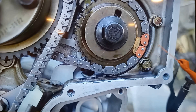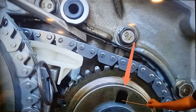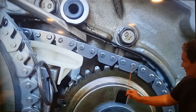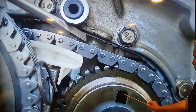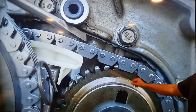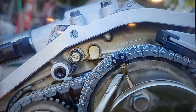On this side, you can see the arrows lining up — timing mark, timing mark, and highlighted links, they're all lining up. This one is supposed to line up 100%, but not this one. The arrow right now is lining up with the hole but not the timing mark — the timing mark is far away. If the timing mark were in this direction it would be lining up, but it remains like this. Don't worry about lining this up; you will never line them up. This hole and the bracket of the secondary timing chain with this timing mark here — see, far away — this is the correct way to install the timing chains, that's how they stay once everything is installed.